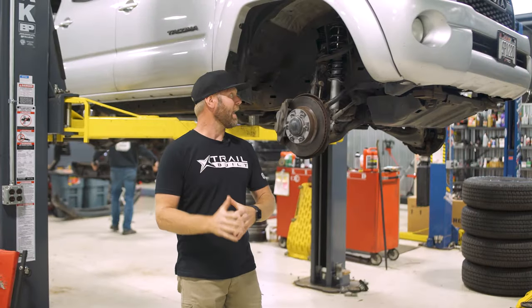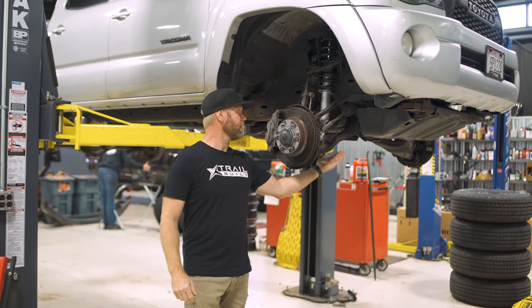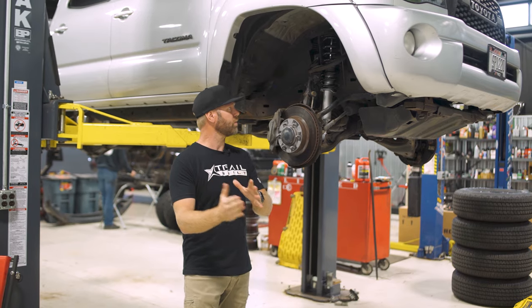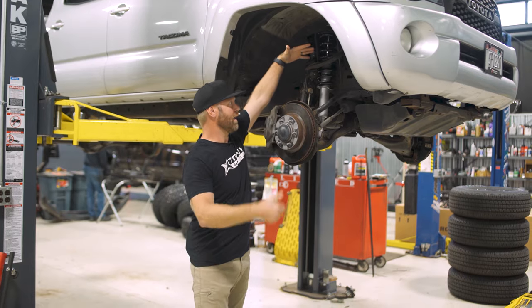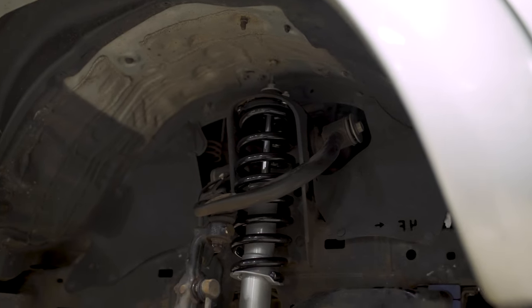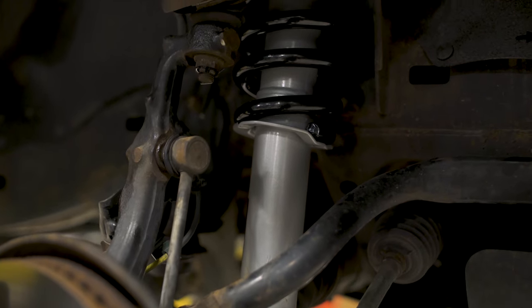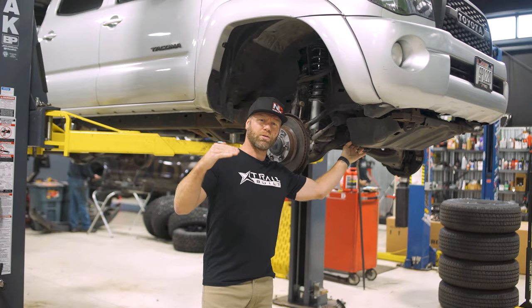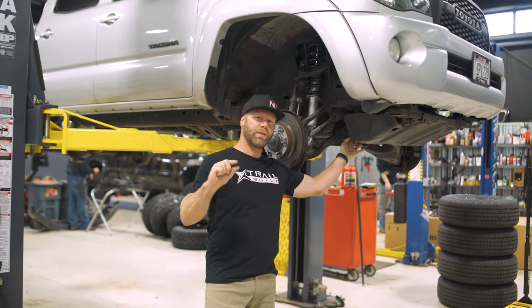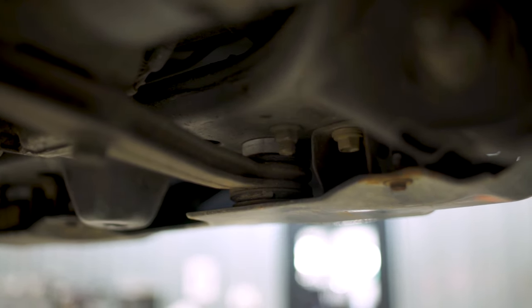Now that Brent has installed the front shocks, the rear shocks, and the puck spacers for the differential, we're going to give you guys a little rundown on how that all goes in. For the front shocks, it's pretty simple — get your truck up on a lift, the old struts come out, pop the new struts in, bolt everything in. These little puck spacers underneath are to drop the differential down just a little bit to help with that pinion angle and driveline angle to keep the front driveshaft from binding. You get a couple of half inch spacer pucks for the front differential.